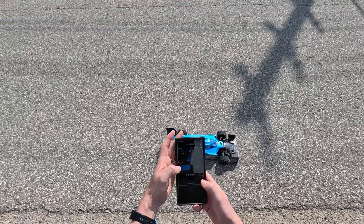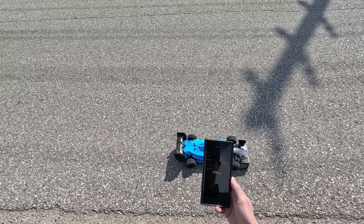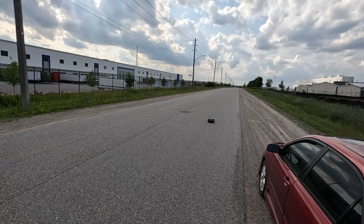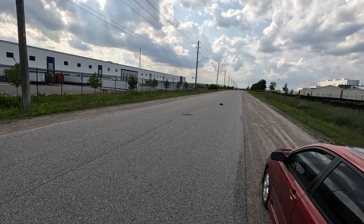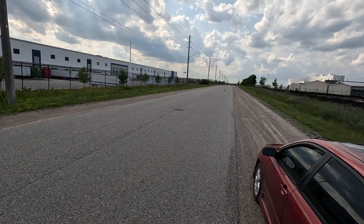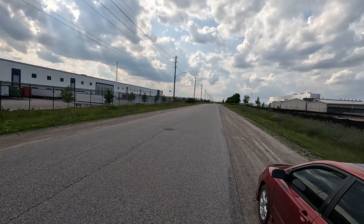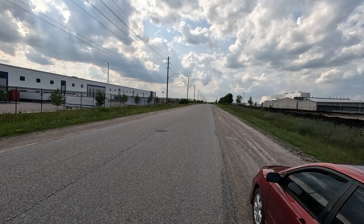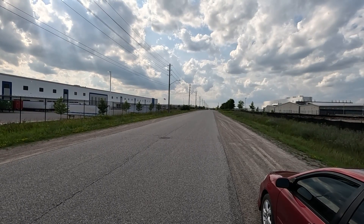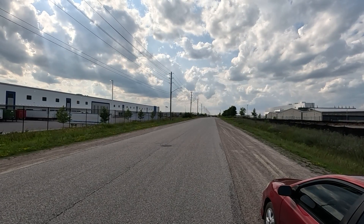Let's see what we got on the speed app — 180 kilometers an hour. After letting the motor cool off for quite some time, I'm going to send it back out for another pass. One of the things I want to talk about regarding the endpoint adjustment is that I wish I had more resolution. Instead of having it at 30 to 40%, I'd want it closer to 100% to maximize the resolution. However, I'm mechanically limited on the servo with only having access to one position.